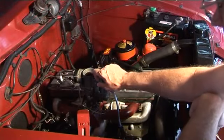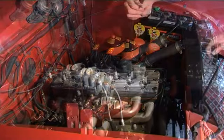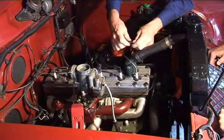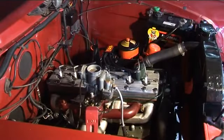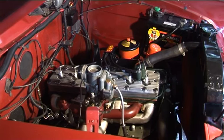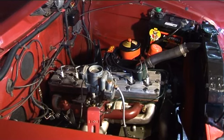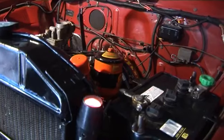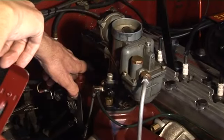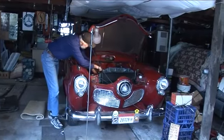I fitted the timing mark for the motor. With the transistorised ignition, that doesn't work, so it's a real fly-by-the-seat-of-your-pants situation — turn the distributor a touch, see if it'll start, go by feel to try and get the motor going. I was fortunate that I'd managed to sort out the timing and statically time it, so the timing was correct and it just burst into life, as you heard.